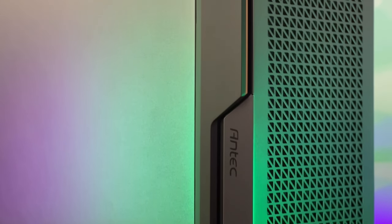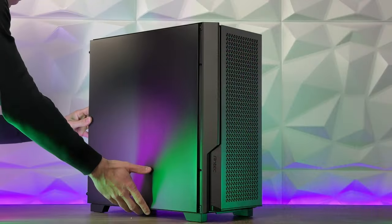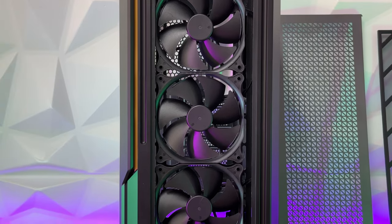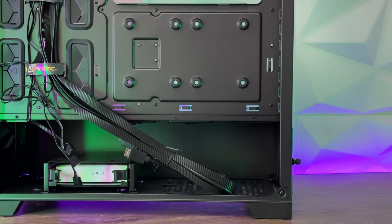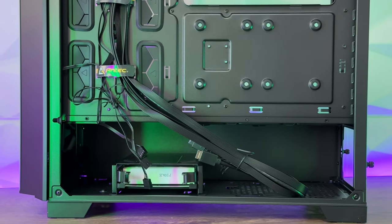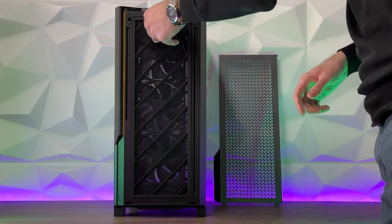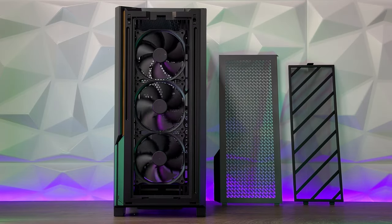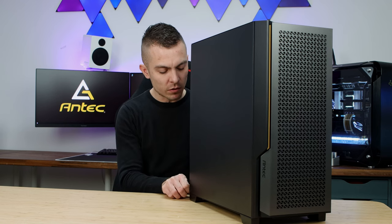The configuration is almost identical to the P20C: three 120mm fans on the front, with the possibility of a 360mm at the top, or 280mm/240mm on the front as well. There's plenty of space in the power supply shroud for cables and a large PSU, plus a hard drive cage. The front panel must be removed to access the dust filter and fans. On the top there's a magnetic dust filter, and the PSU has an easy-to-remove smaller dust filter.